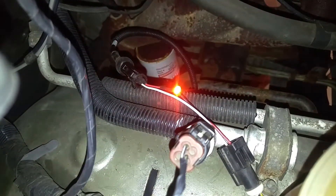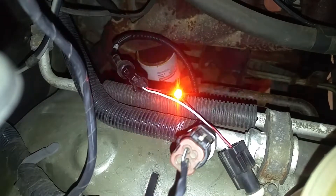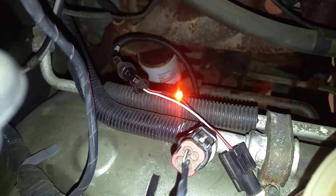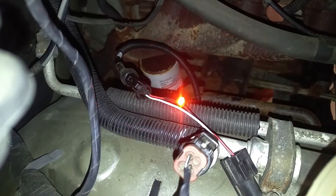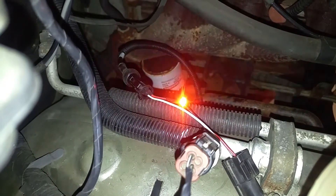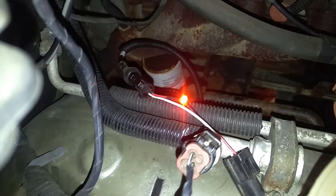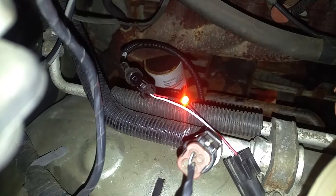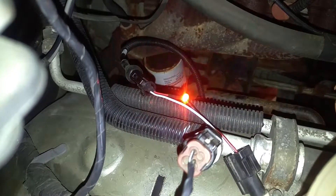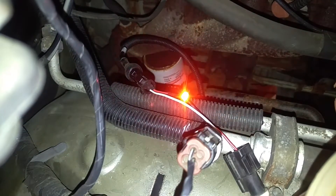Here I'm running the test backwards. I have the LED inside the connection between the supply line and the vehicle going to the right ABS sensor on this 2003 Ford Explorer. This is the inductive sensor, so it has a magnet inside and a coil of wire, and its resistance is about 1K, which at 12 volts is obviously 12 milliamps, so you're not overrunning this current. It's a hybrid LED, so you could go down to 50 microamps and you'd still be able to see it.